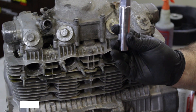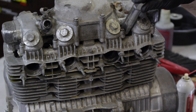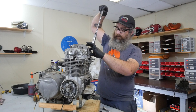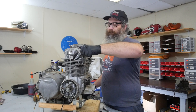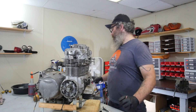This is our part number 9030 — a deep wall 18-millimeter spark plug socket, which if you have a 500K or 550 you need this. It goes way deep in there to get to the spark plug. I'm going to use my little breaker bar to pop it loose. One came out — and look at that. That tells me there might be moisture inside this cylinder here, a little bit of rust and corrosion. More PB Blaster — I'm just going to spray it into the spark plug hole. All the other ones look great, so this one is not so promising. We'll let that sit for a little while and then try to turn the motor over.